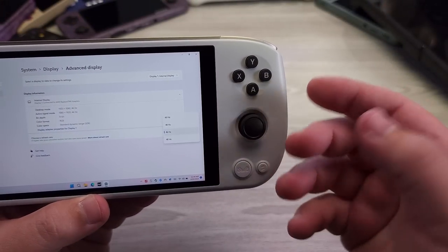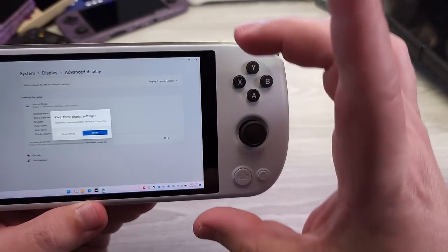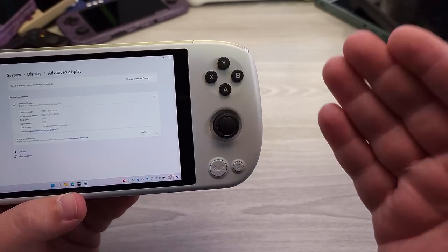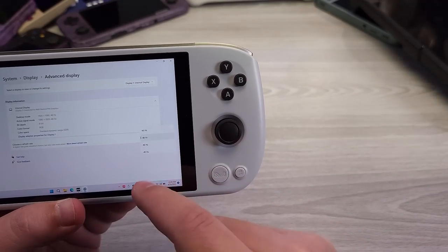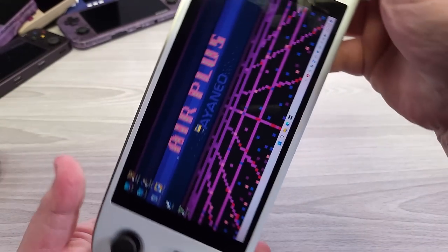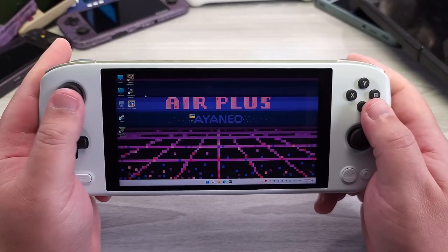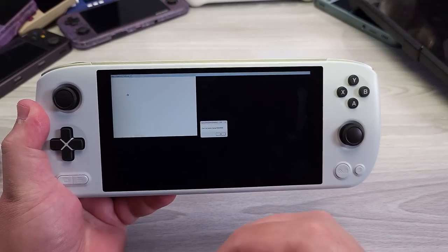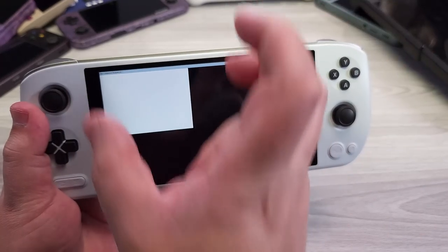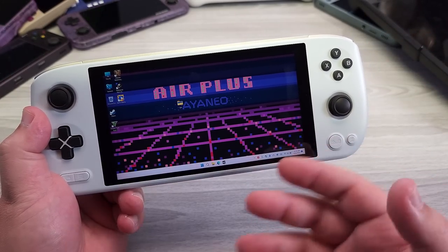Very quickly, let's talk about the display. By default it only has a 60Hz mode. I have 40Hz mode here but that doesn't actually work — we do have 48Hz, and you can also do 45Hz, though you'll start getting a little bit of rollover there. I typically prefer going to 48Hz mode, which makes sure that if you need a game to run at 48 FPS it'll display nicely. We'll go ahead and select 60Hz as the default. One important thing to note: because this panel is basically a portrait-based panel — 1080 by 1920 instead of 1920 by 1080 — older PC games will have difficulty running and you'll need to wrap those.